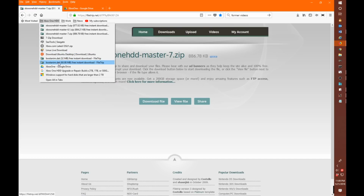And I also have the boot animations linked in the description. The larger of the two boot anim.dat files is for the Xbox One X. The smaller 32 megabyte version is for the Xbox One S and the OG models.